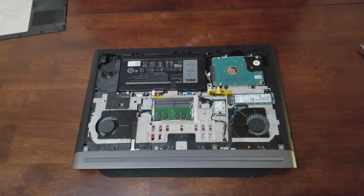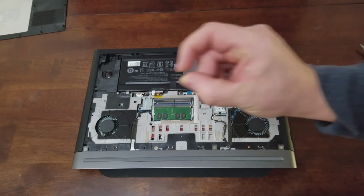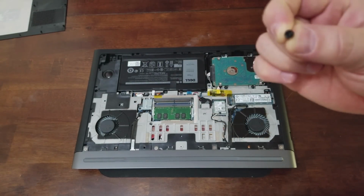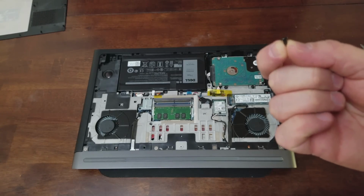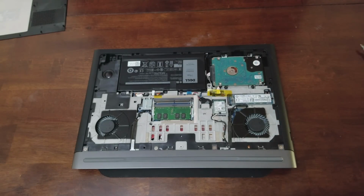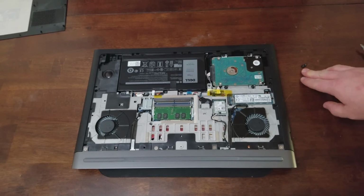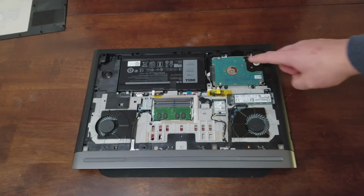And you will, however, need one thing, and that's small screws. I'm not sure if you guys can see the detail here, but basically, you need small Phillips head screws with a fairly fine thread, which would have been included with your motherboard possibly, or your case. So if you have your case box or motherboard box, you may have some small screws that came with it. You'll need 4 of those to install the brackets onto your drive.